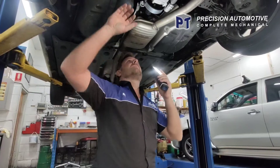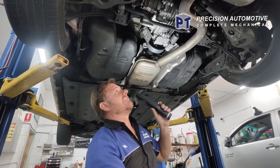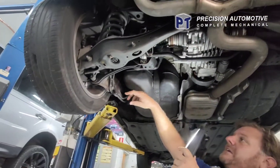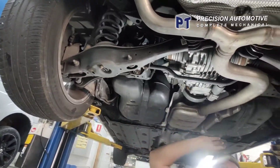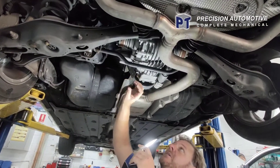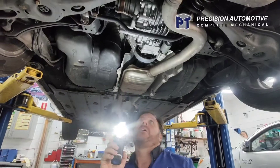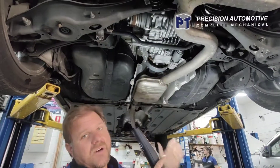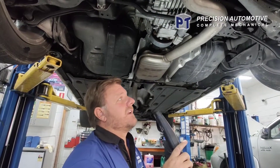What we're going to do is pull it out - it's got to be replaced regardless. You can still drive it, but I'm not going to let it go like that. We'll disconnect the trailing arms, the levelling suspension, brake calipers and everything off. We'll drop the whole exhaust off, drop the whole cradle out, and then detach the differential from the cradle, because the cradle's holding it up and the bolts are in from the top. Once I get that disassembled, I'm going to strip the diff to see if I can rebuild it. I'll pull the Haldex unit off and take some video of that.